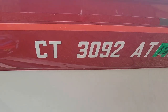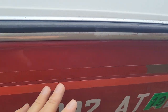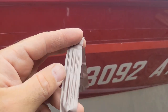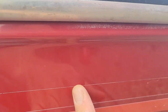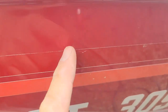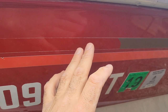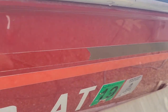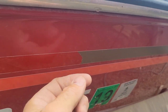So what you're going to notice — I was able to get it to pull up applying a little bit of heat. What I noticed was on some parts, as you're pulling it off, it will start to stretch and get really soft — that means you have too much heat. As you're pulling and it's nice and clean, then you start seeing glue marks — that means it's too cold. Give it more heat. I was doing great, got a little glue, applied heat, gave it too much, and it peeled off. So I've got to go back and start it again. Once it's started, pull up a little bit and you can start over.